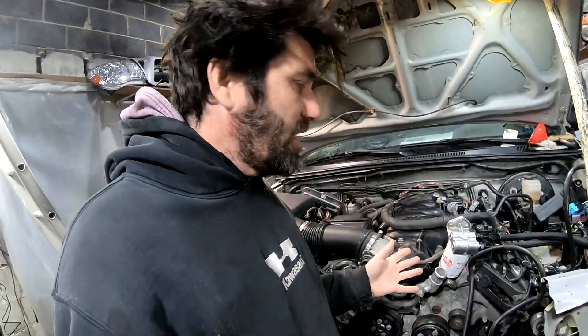I don't know why — we couldn't figure out why — but all of a sudden we got 5 volts. But it still wouldn't start. I had Hatchling Dave over here helping me. He was underneath the truck screwing around with some stuff, and we finally got it to start for like one second — then it would shut back off. But it would only do that when he was under the truck at the crank sensor, manually grounding it.